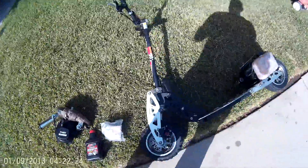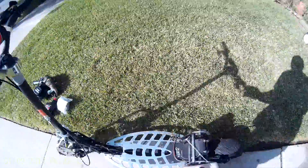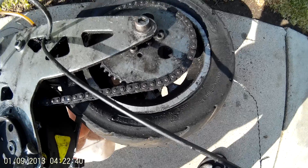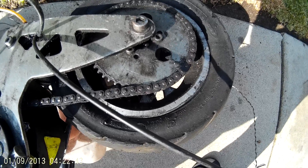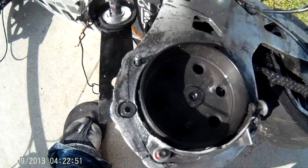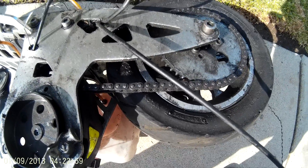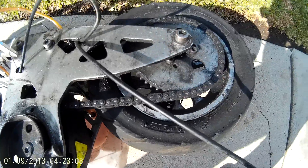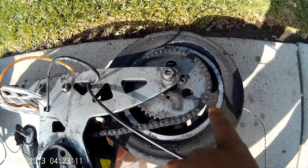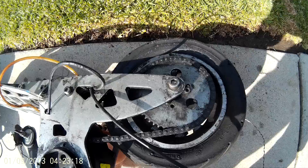I also used a iridium plug. The last upgrade I did was going with a 48-tooth and 11-tooth pocket bike sprocket. The reason is I was chewing up sprockets with this engine — eating them up, the chain was getting loose and stretched because this engine puts out a lot of power. When it snaps the bell it's going hard. I crashed too, but she's still on all two tires. I had to get a new chain and a pocket bike sprocket because that's the only thing that fits on these rims.